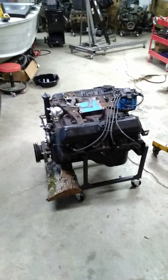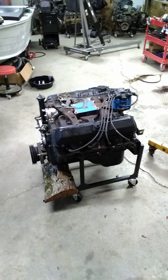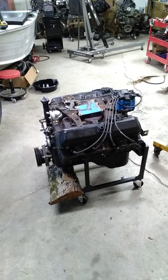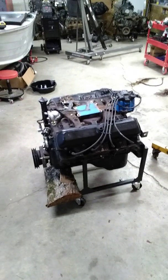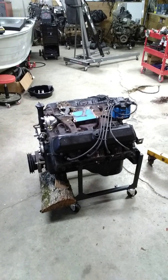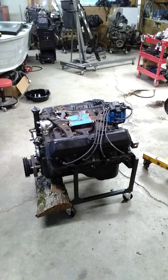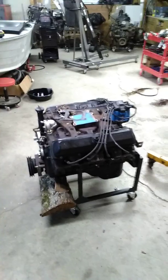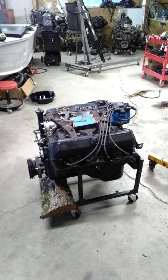It only knocked for a short time, but it worked on the crank enough where I don't want to just throw new bearings in it and squeeze a little more time out of it. That's a desirable year 455 — it's a good, heavier casting block with higher nickel content. I think it's the F-block, it's got GA heads on it — good heads that just need bigger valves. It's a desirable motor to build, so I don't want to trash it. I already cobbled it together when I first got it.